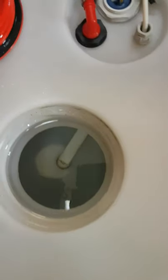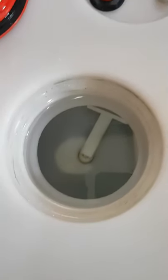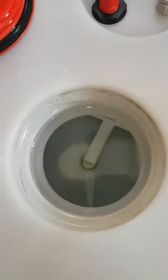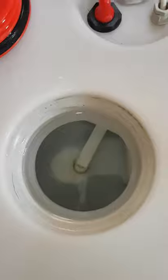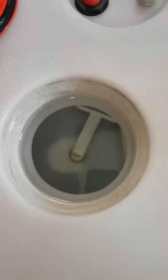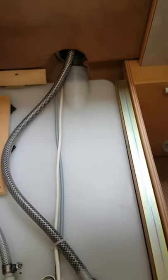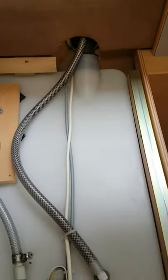Just underneath here you can see your dinette seat — if you lift up the board, your fresh water tank is in here. In the water tank there's a T-shaped handle: if you lift that handle up it'll pull the stopper out and that's how you drain your fresh water tank. Push the stopper back in, push the T-part back the way it is, and it's closed again. There's also an overflow — if you forget to take your hose out it'll just run the water back outside.